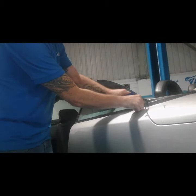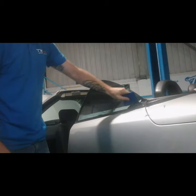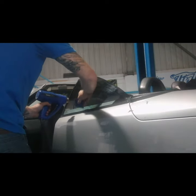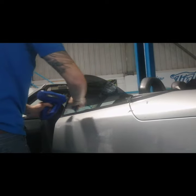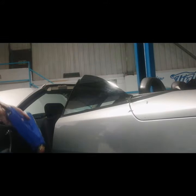We're going to lock down this bottom corner, lock down around the top edge, and also lock down that side. By doing that we're forcing all the fingers to pop up at the bottom. Next we're going to need a heat gun. We're going to heat all the fingers down flat. The reason we pulled the tint away from the edge by about an inch is because we don't want to burn that edge — by taking it away from the edge we're reducing the risk of burning the car.